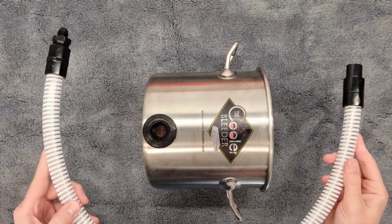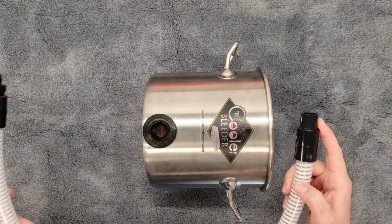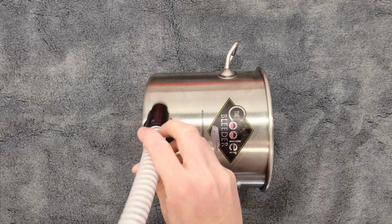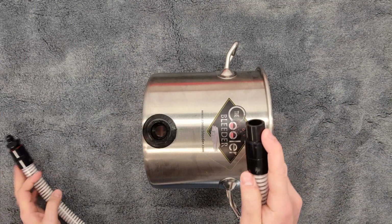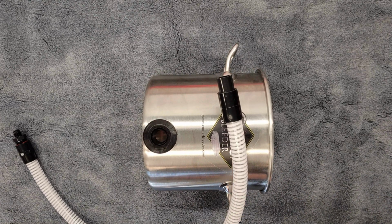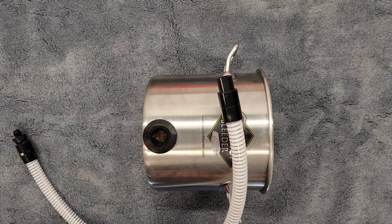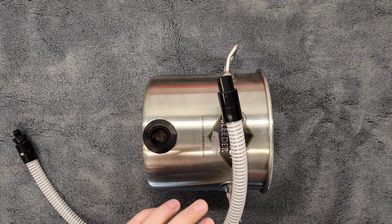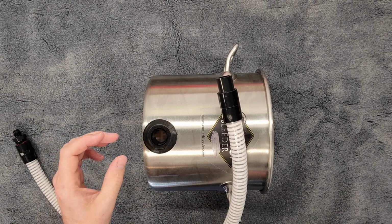So this is our suction hose. This male end here, there's two ends, not the threaded side, just the male nipple, is going to go into here. We need to lubricate this to start with. So when it's shipped to you, there will be some lubrication on it already. If you do decide to take it out for any reason, we need to make sure that we lubricate it each and every time. So we need to do something that's both plastic and rubber safe.